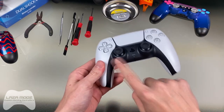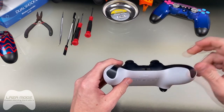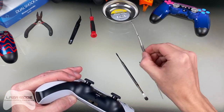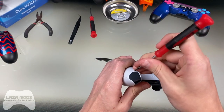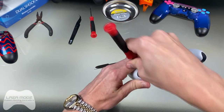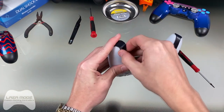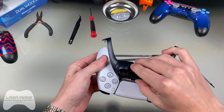The first thing to do is take off this fascia — the trim piece down at the bottom. For that you can use a couple of different tools; I've got a flathead screwdriver and a couple of pry tools. Just very, very carefully slide your screwdriver up under the trim piece here on the bottom on each side, then it's just retention clips that you can pop right out on each side and it will come off the controller.